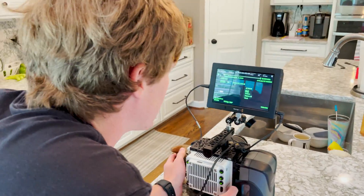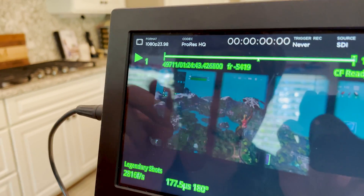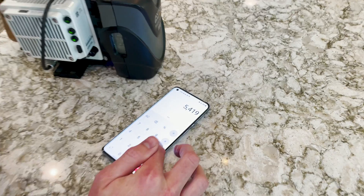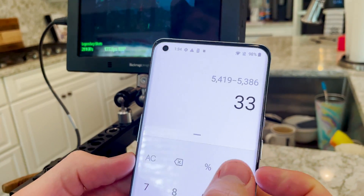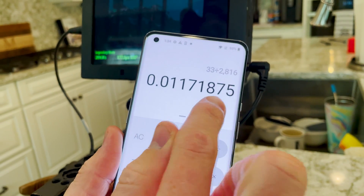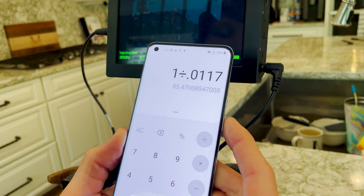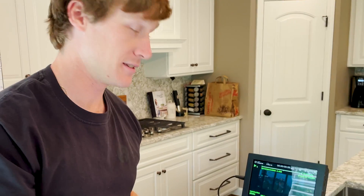For gaming you're okay with using a more intensive frame rate because you want the best fluid experience. I'm going to break out the calculator to check the refresh rates. This umbrella just refreshed on screen — we're at frame 5,419. I'll play it again and pause when that umbrella refreshes once more — right there, about frame 5,386. So: 5,419 minus 5,386 equals 33. In 33 frames, filming at 2,816 frames per second: 33 ÷ 2,816 = 0.0117. Inverse that: 1 ÷ 0.0117 = 85. Ballparking — that's our 90 Hz refresh rate right there.